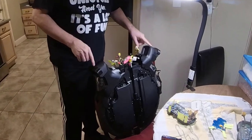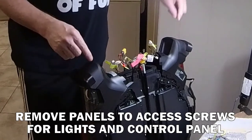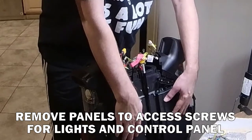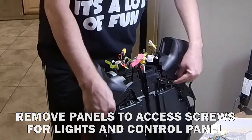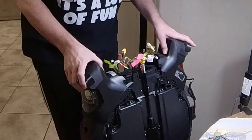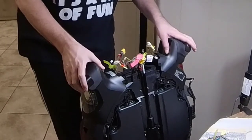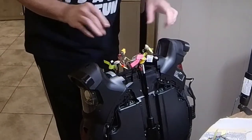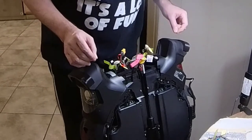The front and back lights — you're going to have to take off the side panels that are covering the battery casing in order to get to the holes for the light housings. Although you don't have to completely remove the light housing, you're going to have to unscrew them and tip them away from the control board enough to get at all the screws and lift out the control board.